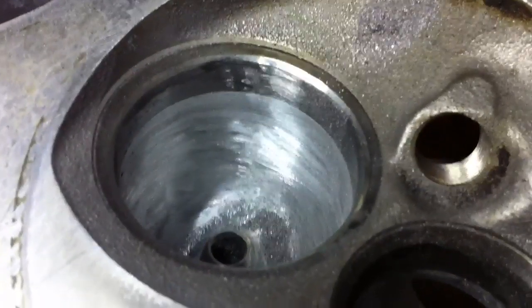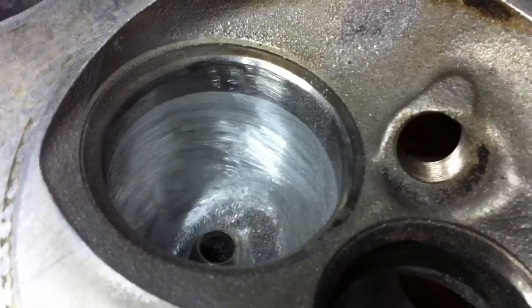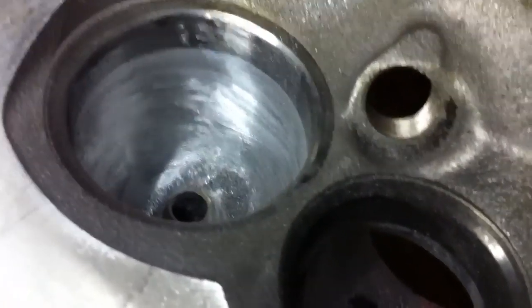There's a better angle. I've gone through and done the intakes with the short mandrel. I'll go back and finish it up with the long mandrel. Now I'm working on the exhaust with the short mandrel first and the Tootsie Roll.